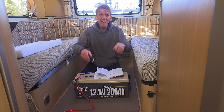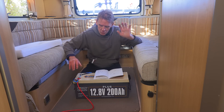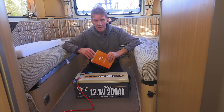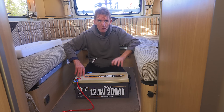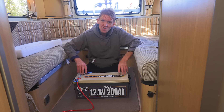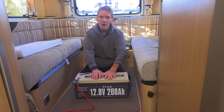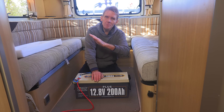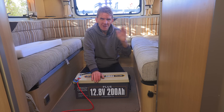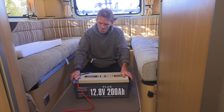The question some of you might be asking is: can you use this battery in addition to your lead acid batteries — can you use them in the same circuit? Well, the answer is no. You've got to keep the same batteries — the same kind of capacity, the same make. If you start mixing batteries, if you put this into the same circuit as your lead acid battery, you suddenly lose control. Although this has got a printed circuit board inside it absolutely managing the power and making sure it doesn't overheat — and when it gets up to about 80% capacity on the rapid charge it goes into a lower trickle charge — if you start linking it to other batteries that don't have that control, this is going to get very confused indeed. So stick to the one type of battery.